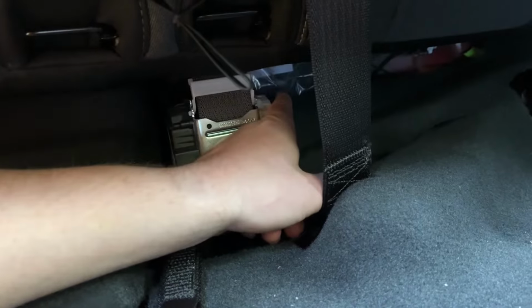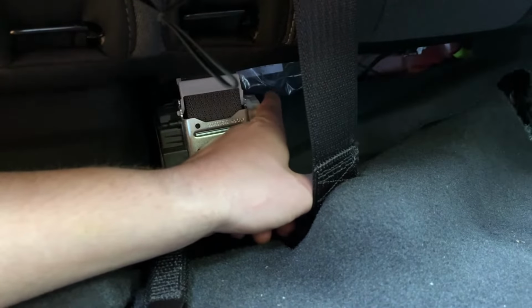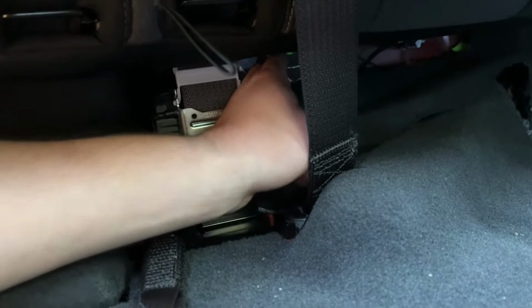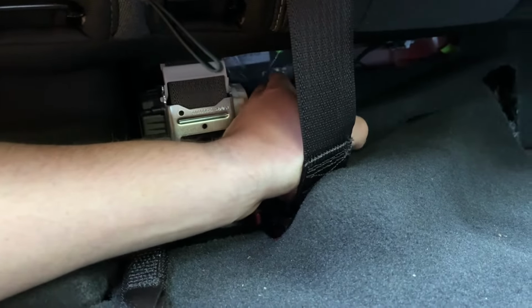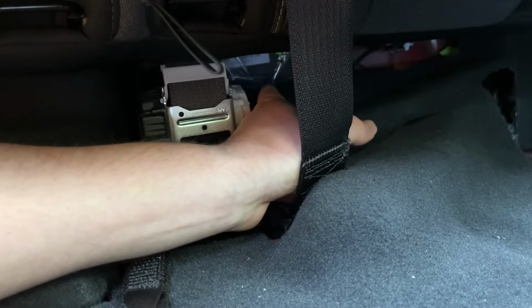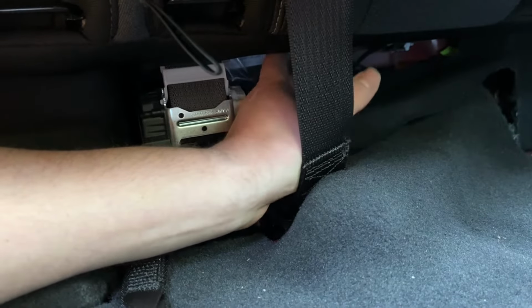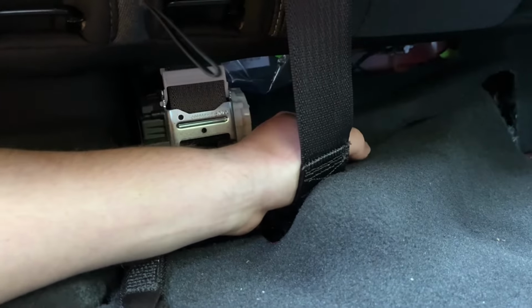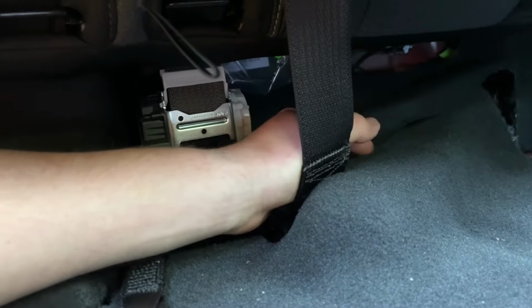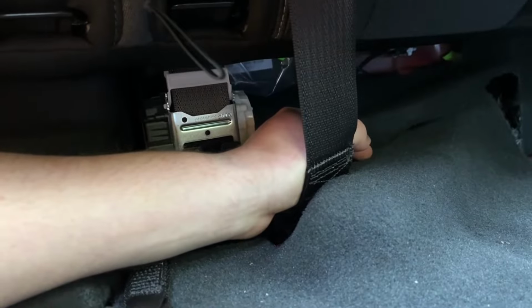I saw another YouTuber who actually had his back window fail pretty bad right in the center, it leaked onto this RF receiver, and I think it's like a $1,600 repair. It is not a cheap repair. So quick, 30-cent Ziploc bag over that thing. It'll be fine then. Definitely do that if you want to be extra safe. Of course, I'm going to do it. 30 cents is worth saving $1,600 right there. It took me about 30 seconds to install.